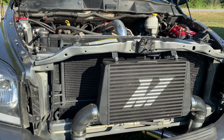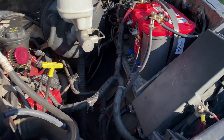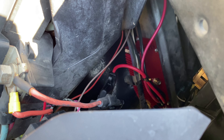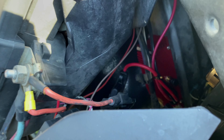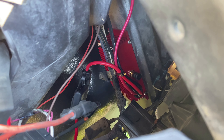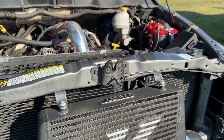Let me show you guys how to throw this thing on — it's really easy, especially the way we have it mounted. Our supercharger is doing a good job, everything's been solid, it's making enough power that we can't even get enough fuel to it. Right here on the Kenny Bell is where we want to plug in the step-up plug. Push it in — and boom, it is on there. It's going to tell it now, 'Time for 21 volts when we kick on.' Simple as that. Let's go take this thing out for a spin and get some data logs.